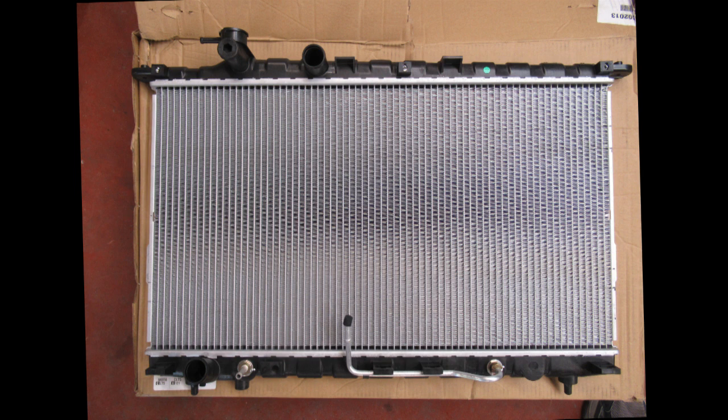The two projections at the bottom of the radiator go into the mount cushions. The oil cooler line shown pointing up with a black cap on it actually needs to be bent down some — you can wait until you put it in the car to do so. I also pulled a slight vacuum test on this radiator just to be sure there were no leaks, and there weren't.